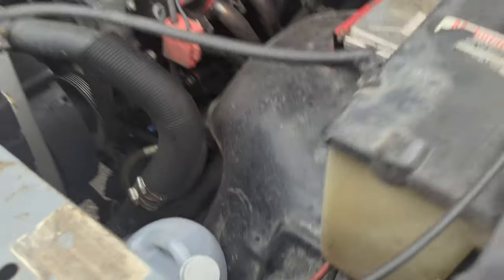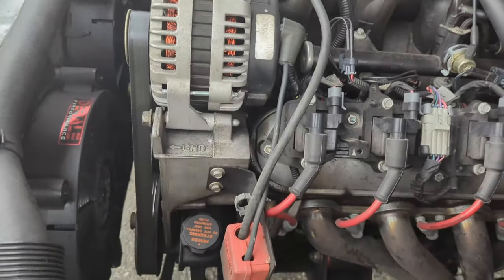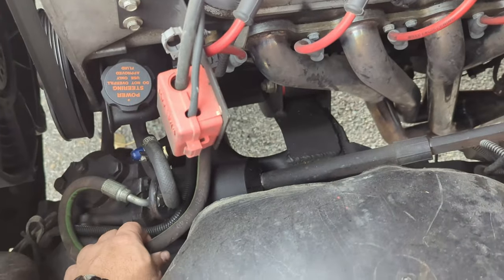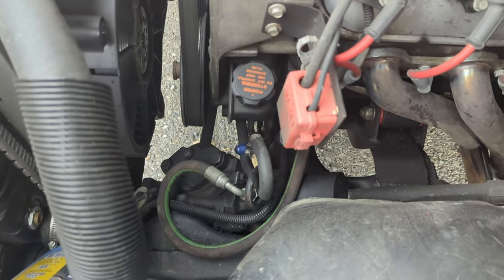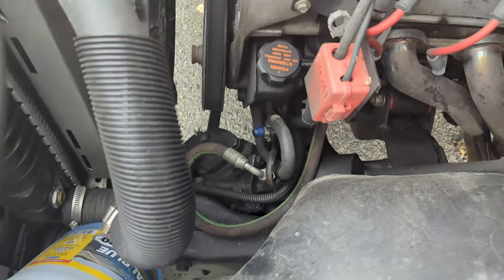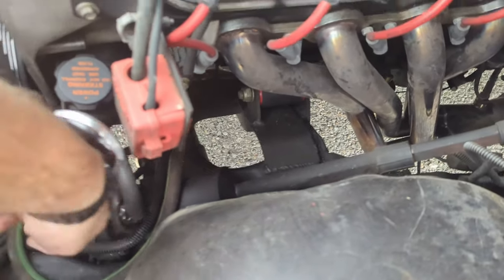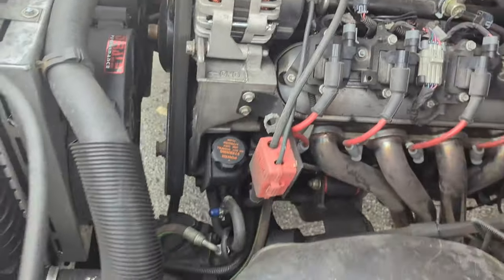Here's the engine. The wiring needs to be cleaned up, but the biggest and most important change I've done on this truck since the last update is this hose right here — the power steering hose. It's quite high pressure. Originally I was running a 6AN line on that and I had to change it to a hydraulic fitting. You can get those at most local hardware or auto parts stores. I'm still using the original 6AN fittings that go into the Ford box and the GM pump, because the flares on JIC and 6AN are the same, so that works out pretty good.